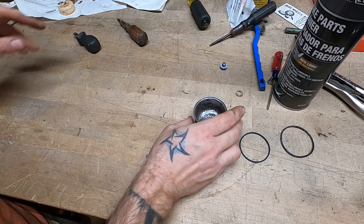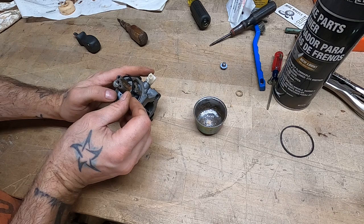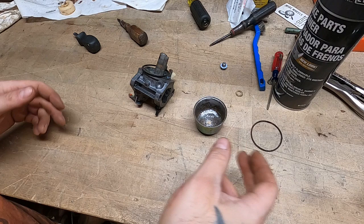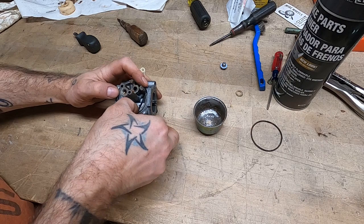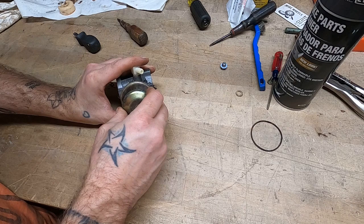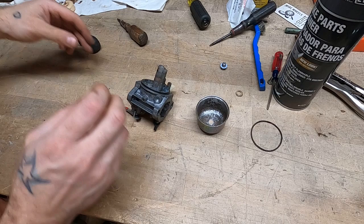And bowl gasket, right? This one's a little bit of a taller order. But we'll give her a shot. I mean, certainly this one was gonna leak. I will tell you though, what I've been doing with these recently, clean them off the best you can, nice and gentle with some soap and water, and then douse them in WD-40. It brings them back a little bit. If they're really bad, instead of dousing them in WD-40, you rub them down with RTV. Is that the right way to do it? No. Is it even remotely an okay way to do it? I don't know, maybe. Yeah, that feels like it's sealing. It's not metal on metal. That's touching the rubber, so that just might work. Crazier things have certainly happened.